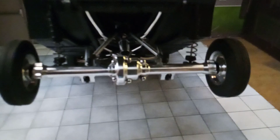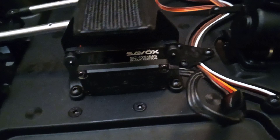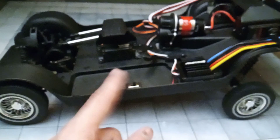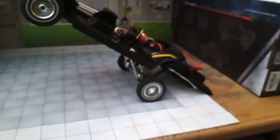We've got the whole rear end all chromed out, looking real fly. Now with this Savox Black Edition in here — part number SC-1251MG — it only has about 120 oz-in of torque but 0.07 seconds on speed, so it's really fast. It just doesn't have enough torque, so with the body on, the car won't sit right in the back.